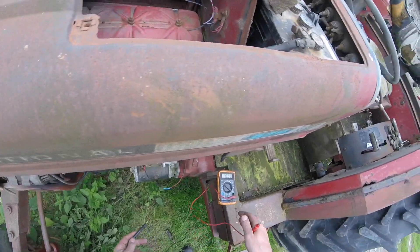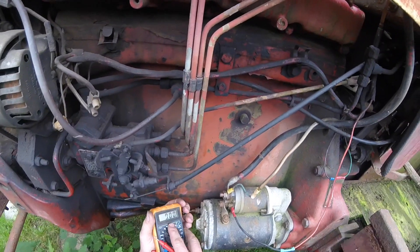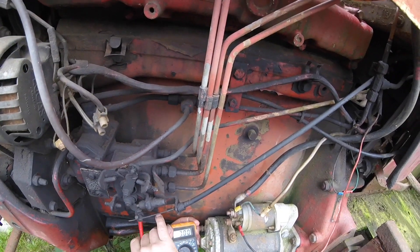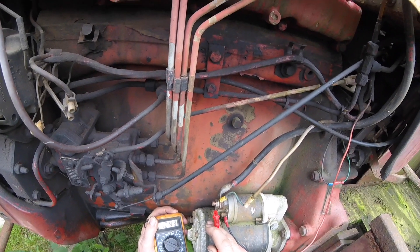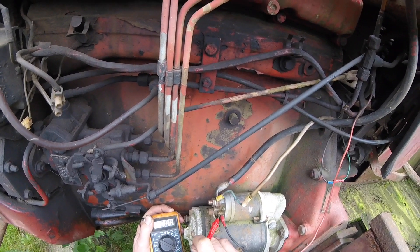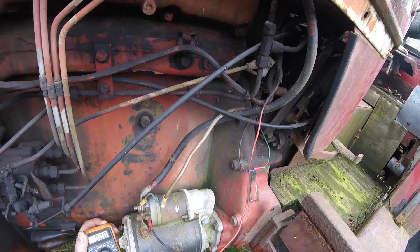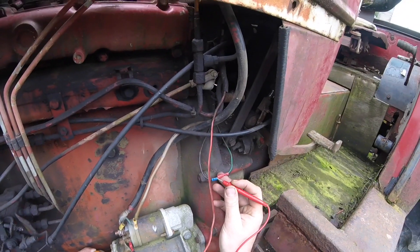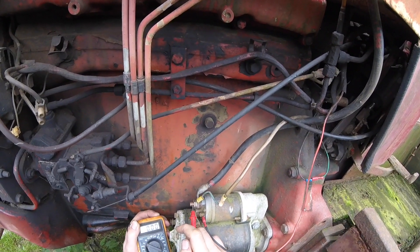That's an earth down here — I think that's an earth there. That is coming down here — that's positive. Hopefully I can get an earth here now. See? 12.42. So you know that's positive. Then the two positives there — 12.42. Same as the ones I showed you before that were earths — should be nothing there. See? Nothing. Very, very simple when you get used to it.